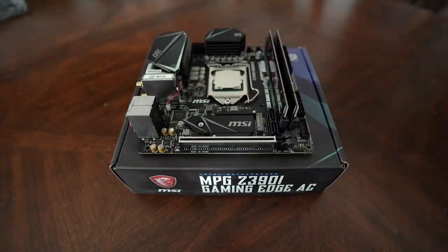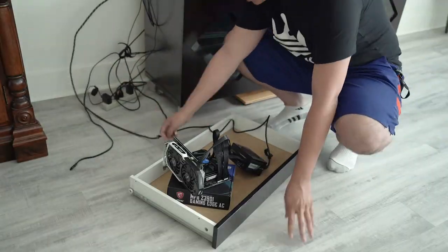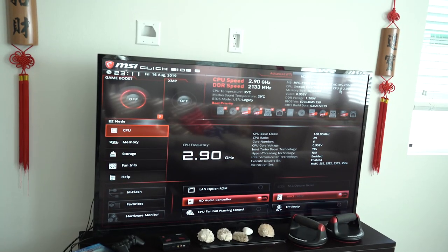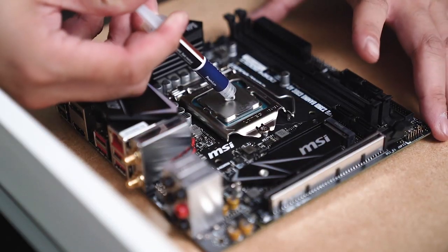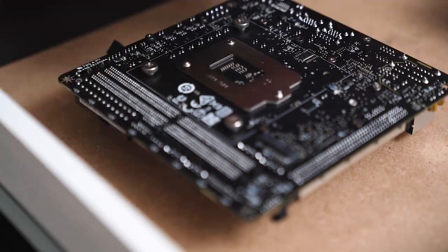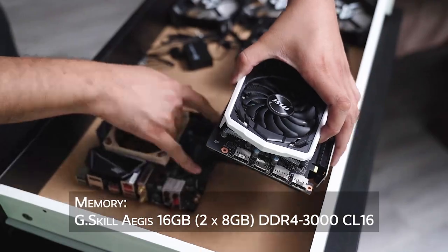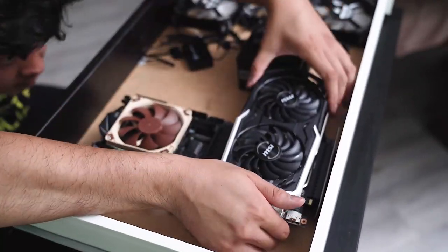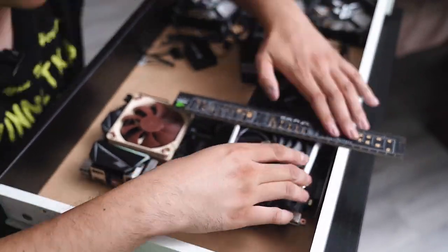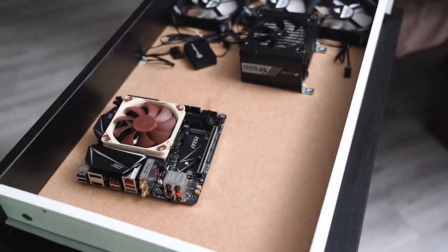While I was waiting for all my parts to arrive for this build, I went ahead and tested the system just to make sure it would boot. Once the test was complete, I swapped out the stock CPU fan cooler for the Noctua NH-L9i Low Profile CPU Cooler. I installed the GPU to the riser cable and that to the motherboard so I could figure out the layout and clearance of the GPU. I had to remove the rear IO bracket on the graphics card to make sure it would mount horizontally onto the back of the drawer.